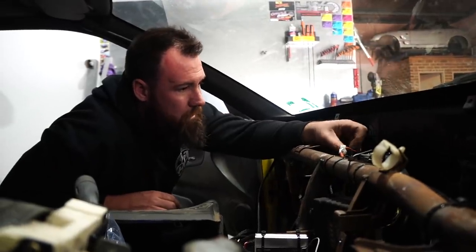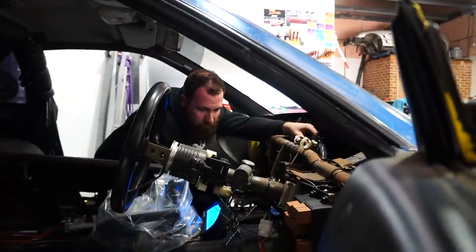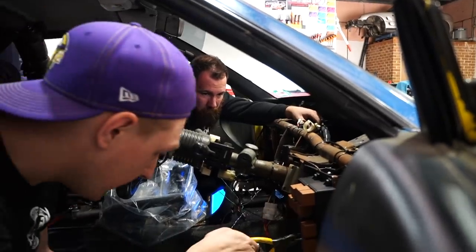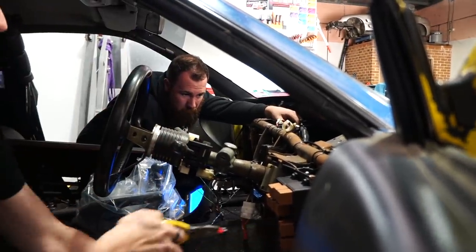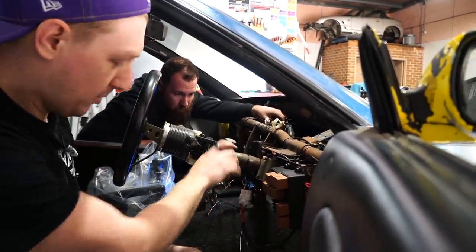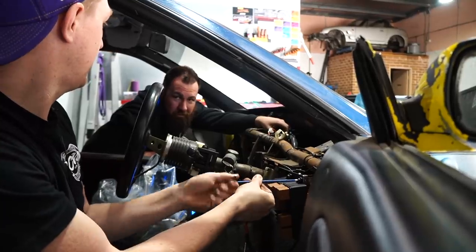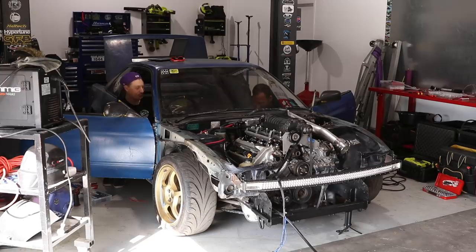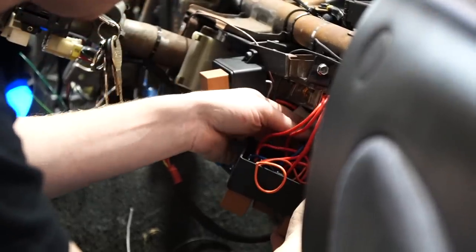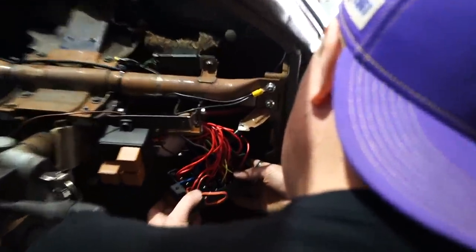Is that the powering the ECU, right? You reckon that's fuel pump and fan trigger? Yes. The blue and the white one are fuel pump and fan trigger. Maybe just look more at the fuel. Fuse 4 goes to relay 1, yes. Fuse 4. That is technically no power to ECU currently, according to my diagram. I will pull that off and double check it. The ECU has power, it does. Which is good. That's the opposite of the problem we want. Yeah, when it has too much power. It must be that power to the starter, because I don't think that was connected on Adam's car.